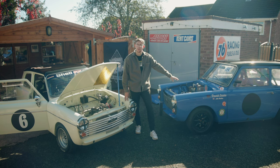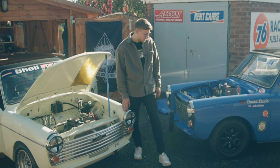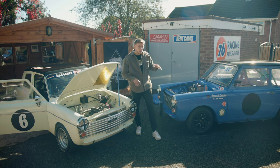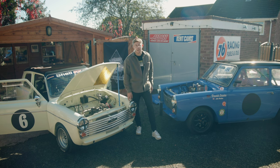Both cars have got a very similar suspension setup. This car is fitted with 800-pound springs on the front and 250 on the back, whereas the other is fitted with 750 on the front and original springs on the back that have been re-cambered to drop the car down. There's quite a lot of talk in the paddock about how to set these cars up — it does come down to the driver. A lot of people like to go stiff with the anti-roll bars on the front because you can't run them on the back, so you do get quite a lot of body roll, especially with the high centre of gravity. They're sort of compared to Minis, but they're a bit longer and the drive goes through the rear. There are lots of photos of me with one wheel up — when you push them they lean over quite a bit.